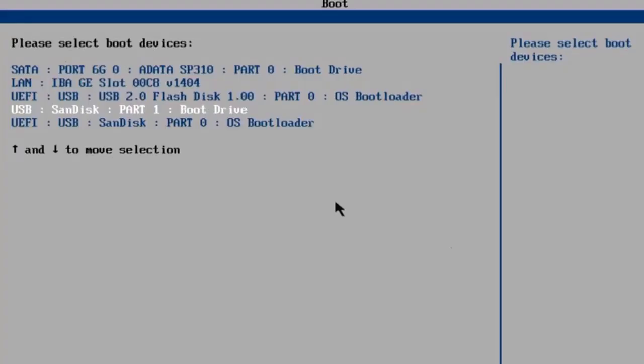I will power my computer on, and then I will press F10 to bring up the boot selector on startup. I will choose the device I want to start from — in this case, one of the USB entries. If you don't pick right the first time, restart and try a different option. Now there are two different screens you might see at this point.